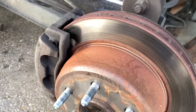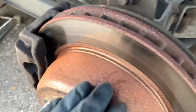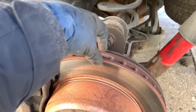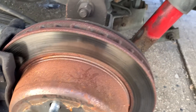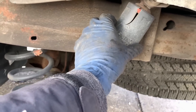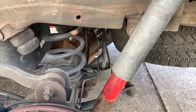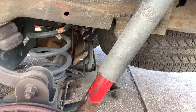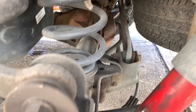It looks like we have brand new brakes back here — I mean, you can see there's still some clean metal showing on the rotors, pads look good. So it doesn't look like I'm going to have to do anything to the back brakes, but I am going to have to address that parking brake eventually. Shocks look like they've seen better days — definitely going to go about replacing these. Maybe I can get a set of Bilsteins to put in here; I believe that's what these came with from the factory, at least all the Trailblazers did.